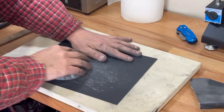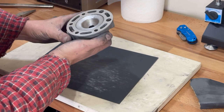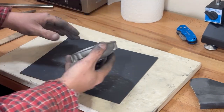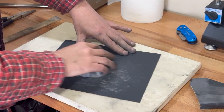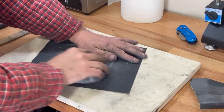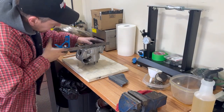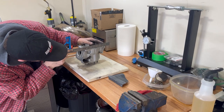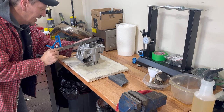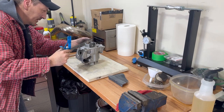If I had bigger sheets, we could tape it down. But just cleaning it up — you can see that's a perfect flat surface. We can see a little bit, we're going to do a little bit more in areas that weren't touched, spin the paper around. This 1000 grit really doesn't remove much of anything. Check the cylinder — perfectly flat — all the mating surfaces are the same height. That's really good.